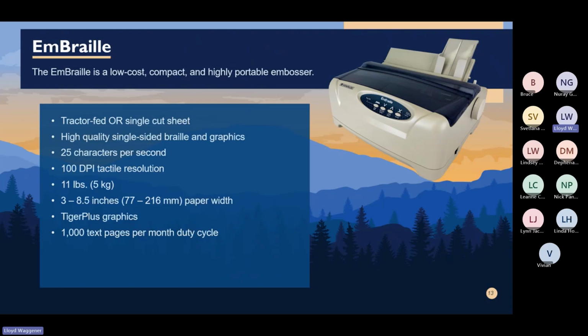This still does a very high quality single-sided braille and tactographics. You get the option with this one to do tractor feed paper primarily, but you can do a single cut sheet. And this does 100 DPI, so you get that really high resolution. It's a hybrid mix where it still has the platen, but it is a polymer platen, so you get the full 100 DPI resolution. This does have the Tiger Plus graphics, and it is rated at 1,000 pages per month.